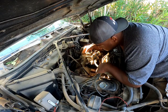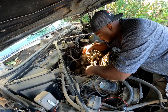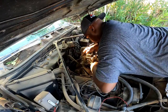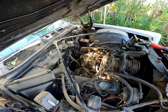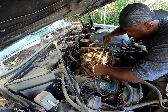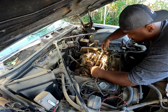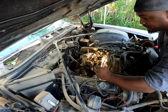And you know what? I'm thinking about the wrong car. I need to replace the choke on this car. The whole arm is gone. And truthfully, I think it's been gone since I had it. But here comes the fight. This hose. Let me grab a flat head screwdriver, see if I can persuade it to come off. Yeah. You know, this thing here is on tight, dude. It holds. It grips. I still got a hose clamp on it, but I just noticed I didn't even put the hose clamp back on when I put the carb on. Alright, it's off. That's not so bad.